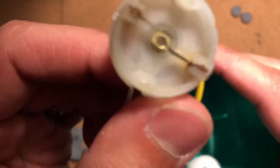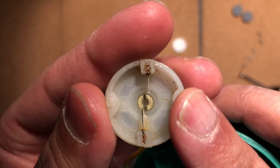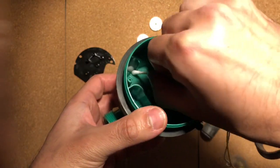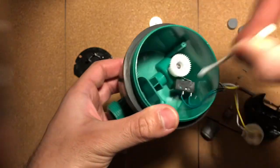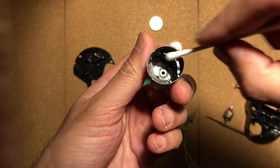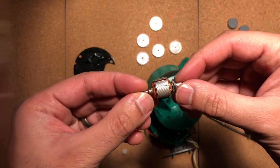For cleaning, if you do have water ingress like I did, or any other kind of dirt, using cotton swabs works perfectly — they get right down into the corners and pick up any residual moisture. You can just see a bit of water down there still — any residual water, just take it nice and slow because you don't want to have to come back and do this all again. The cotton swabs work really well for the motor. Clean the plastic face plate as well. Now that everything's clean, you're ready to put everything back together.